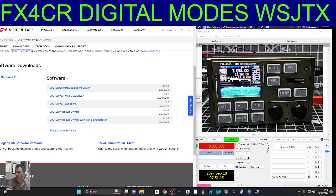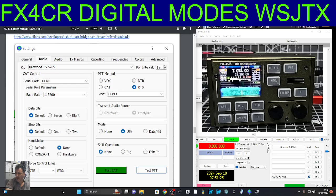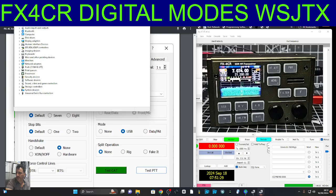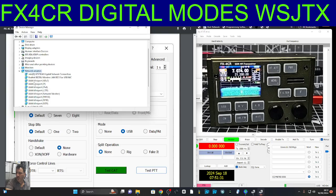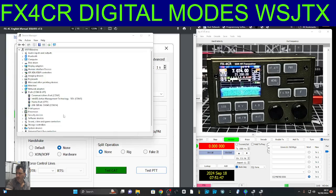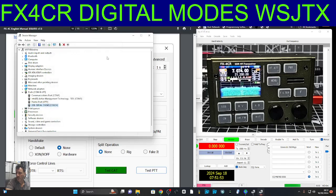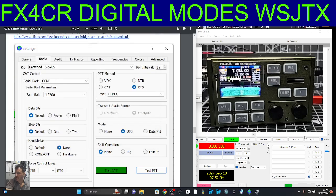What I'm going to try is uninstall and reinstall, but I thought I'd show you the settings. The other thing to check is when you go into Device Manager and go to Ports, right-click Properties and just make sure you're on 115200. My COM port number is 24, but on here it's 3 — you put your COM port here, COM3.